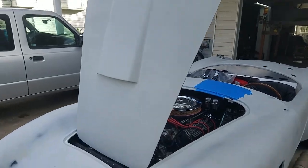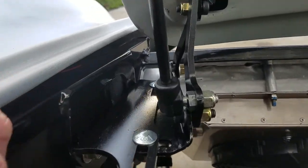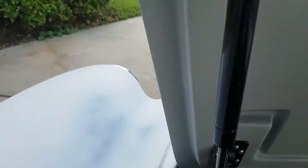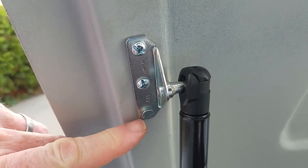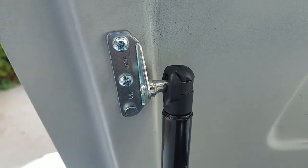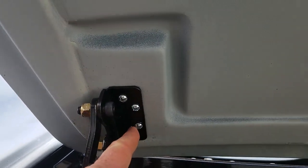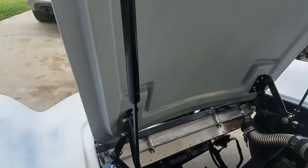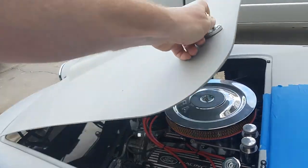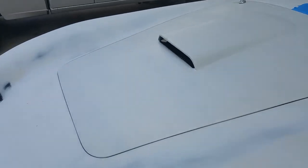The hood hinges are on, not quite perfected yet but they're on. I still need spacers and washers to keep things aligned. I ordered some 10-24 riv nuts and put them in the hood instead of just the rivets they give you. This is the Factory 5 hood hinge kit — it's about the best I can do right now, and it's presentable.